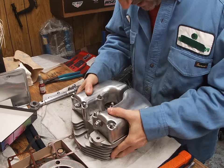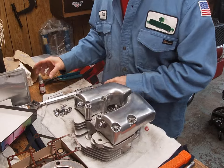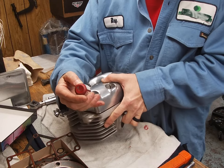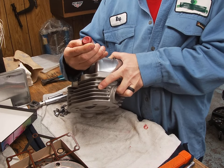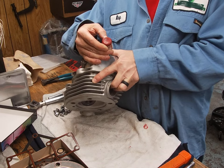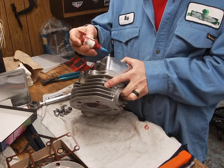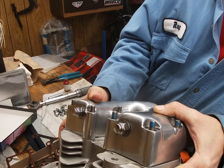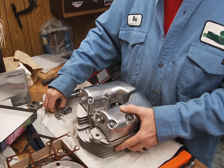These are ready to be bolted now. The nuts have lock washers or lock nuts, but with Harleys I always add some Loctite regardless — even with nylock nuts. I don't go crazy with it in case I need to get it off on the side of the road, but I do want some on there. Then I put my lock washers on.